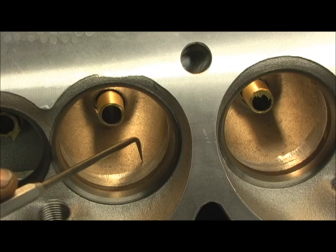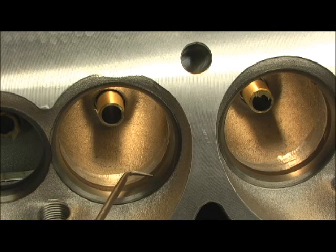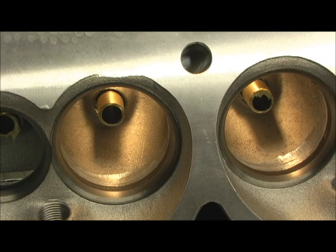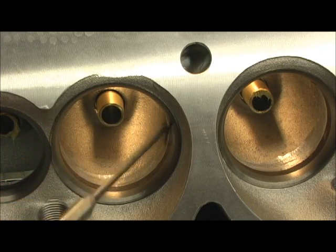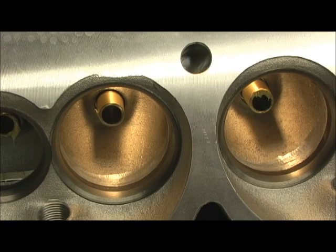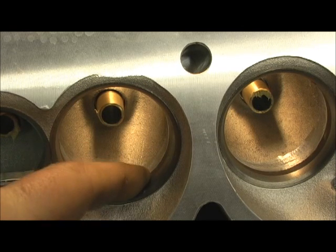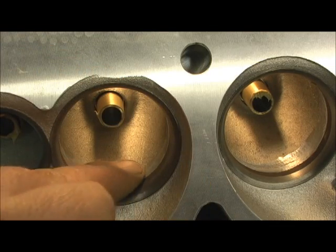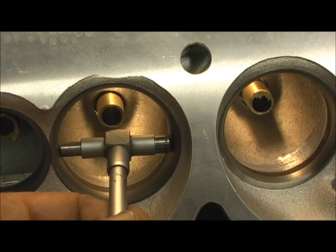You can tell — like I said — a cylinder head that is properly blended, you can't feel a transition where it goes into the seat. With this head, you can feel the aluminum and then plain as day feel the cast iron seat. So when I go in there and do the valve job, I'm going to have to put my scribe tool back on there and take a carbide cutter and cut the seat and pull it in, then let the aluminum roll over to it to straighten it. That's the part that really upset me the most — it wasn't the seat runout, it was this horse shit they did when they hand-blended this and went into the seat and made a messed-up bowl. I just wish you could stand here with your fingers and feel this transition, but I tried to show it to you the best I could with the snap gauges.